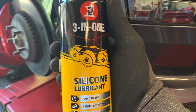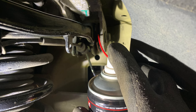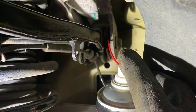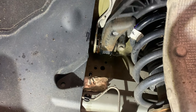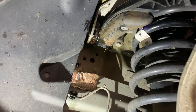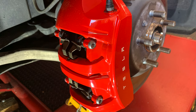At the same time, with some silicone lubricant I sprayed the bushings at the back — there's a little video of me doing that. It's not easy to get to and film with one hand, so apologies for the poor camera work. Once it was sprayed I wiggled it up and down to work the silicone lube in, and that seemed to sort it all out. While I was there I had a quick check of the brakes.